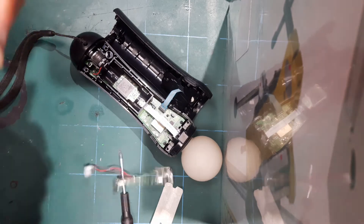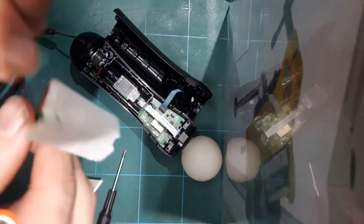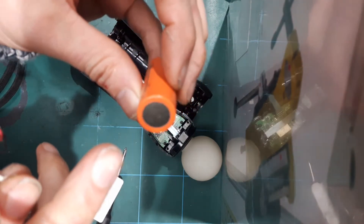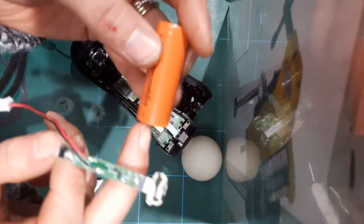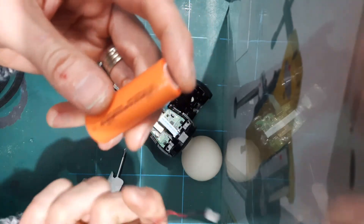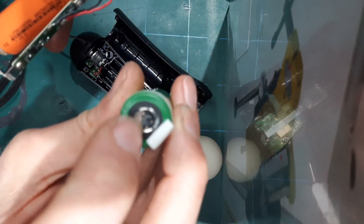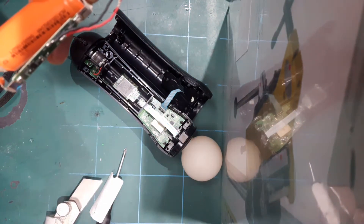Just gently put a knife under there and do that — there we are. Now, I haven't tried soldering these, but I suspect it might work or it might not. These are lithium-ion batteries, and especially with LiPo batteries it's very difficult to use standard solder to get things to stick. On this original one, it was actually just press-fitted and crimped onto the battery — it wasn't soldered. You might get away with soldering, but you might not.